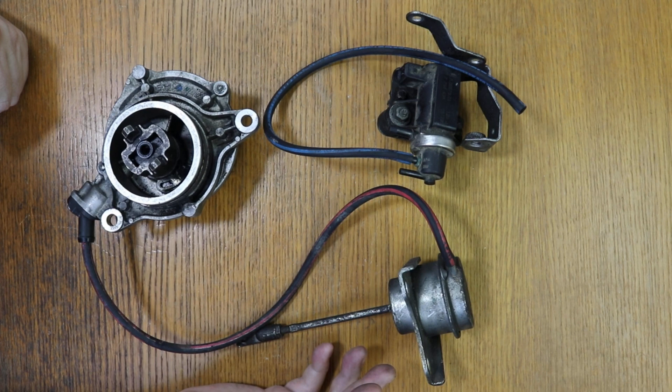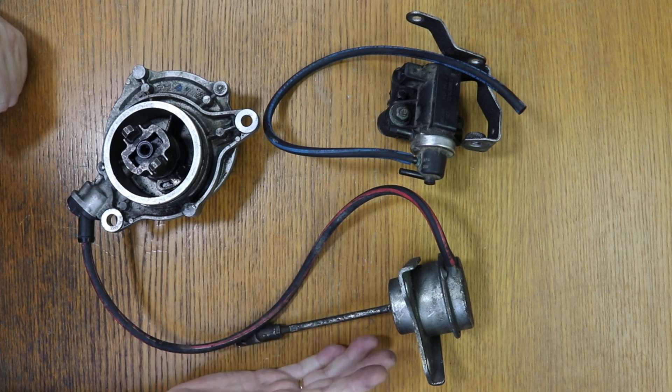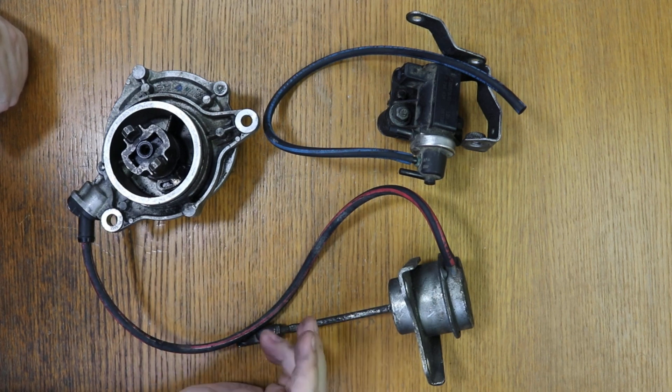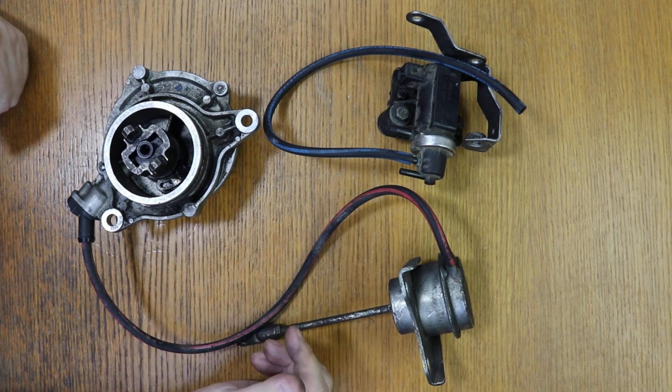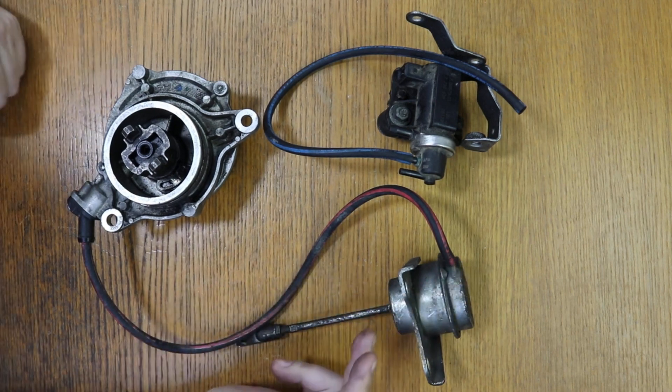This cannot be done like this. There are those who do this test simply to see if the turbo actuator works, but nothing more. You cannot run the engine like this. If the ECU does not have control over the turbo, because the turbo solenoid valve is used to control the turbo pressure, you may have the engine going into emergency mode — in the best of cases — and in the worst, the engine blows up.